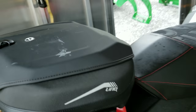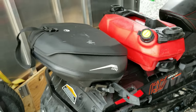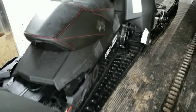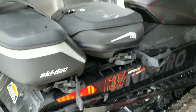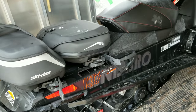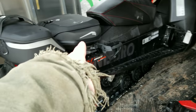You can't put this — it just doesn't fit there with the fuel tank. The fuel tank pops off pretty easy and we have a lot of space on there, but if I try to put this guy on here, I can't get these brackets in there — it doesn't fit. So the only way you can use these two bags on a 137 track is if you have the fuel tank to mount that bag on top of.